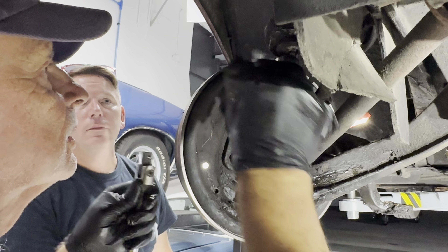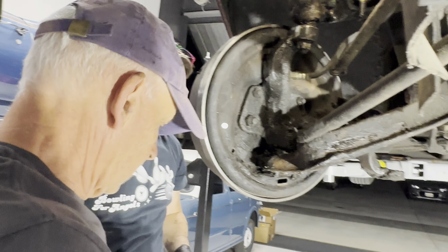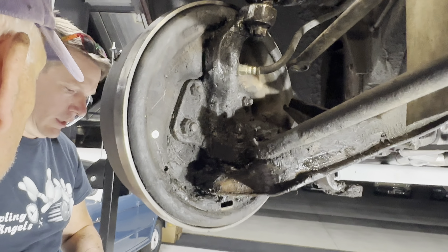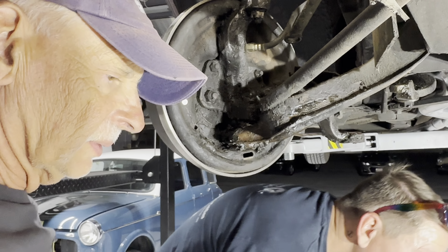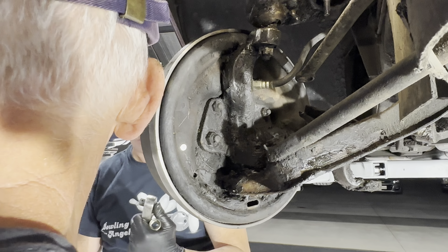Take the nuts off and pull out the center link. Look at that, boys! You were saving the nuts — they're new ones. Yeah, they're historically accurate — the first 60 years of them are the hardest! Look at that, they actually came apart halfway decent. Hard bars are in pretty good shape. All right, pull your center link out boys — oh, that's nice and loose. Does that look like it's been replaced? It's hitting something — it probably has. There you go, pull it out Peter! Peter's got the center link — I feel strong! All right, that's done. That's gonna go in the garbage — we got new everything.